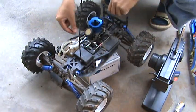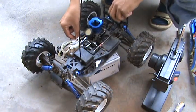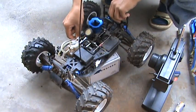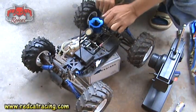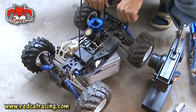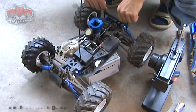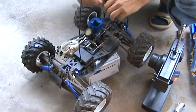To stop the engine it is very simple — pinch the fuel line, and it will also tell you if your low end is okay. When I pinch the fuel line, before the engine quits, the engine RPM goes high for one or two seconds and then the engine quits. That shows that our low end is properly set up.